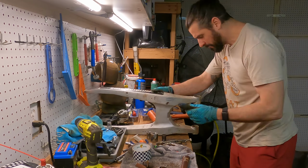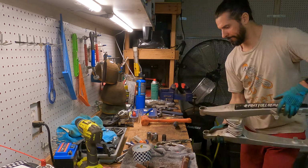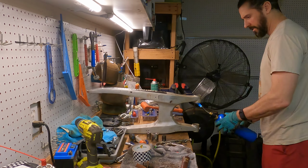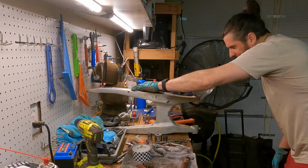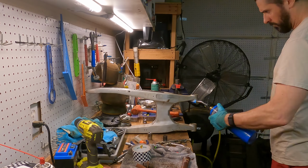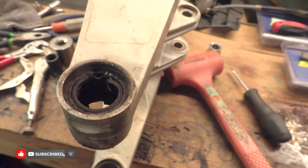This is that exploratory moment in time where you don't totally know what direction to head, so you lightly start trying things to see if anything starts to create movement towards a solution. I would heat up the swing arm, tap on it with a large punching hammer. Then I would heat it up again and start hammering on a socket with a sand hammer. When I didn't see any movement here, I decided to try putting the swing arm in the vise. As you can see, these first few learning moments revealed nothing more than I was in for a very long day.